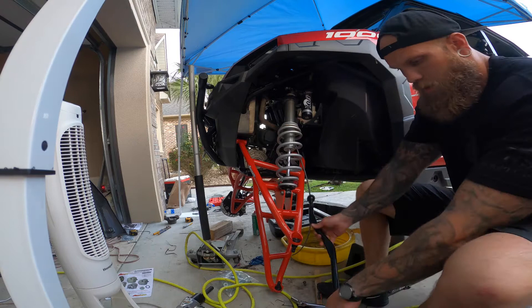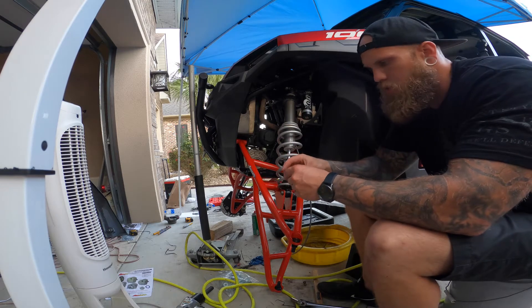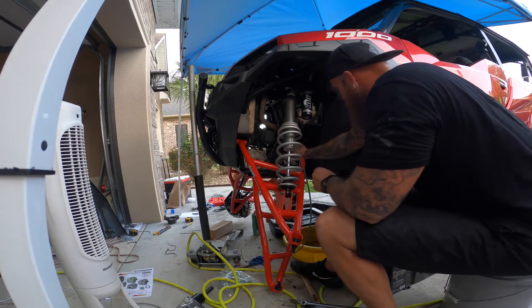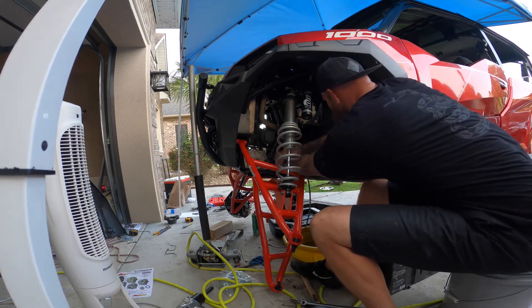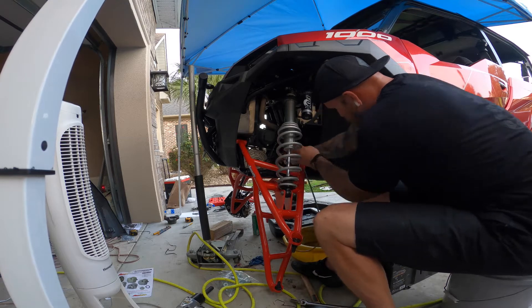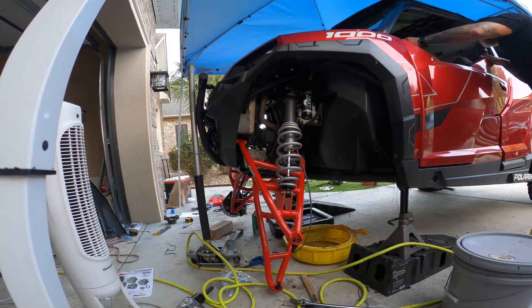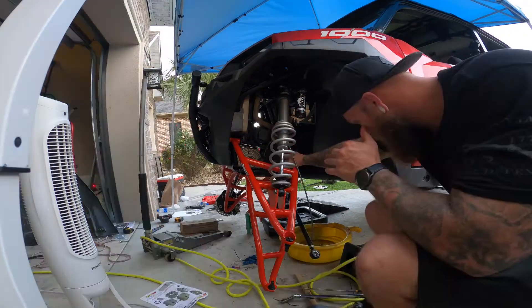We're going to go in right here. Almost forgot something — this can be tricky. This is a steering stop washer, so you can't oversteer with it. Probably going to have to turn it. Got it on. We're going to push it all the way up tight against this edge, keep our fingers crossed that that was their goal. And then I'm going to try and center my steering wheel. All right, that's centered. Work with it centered — it'll save you some hassle.